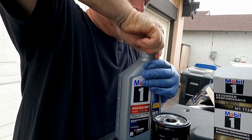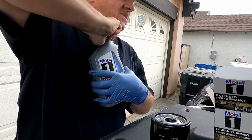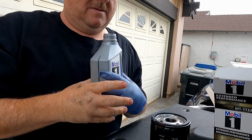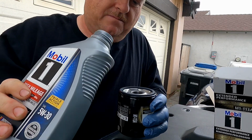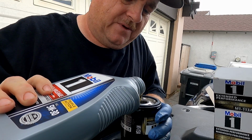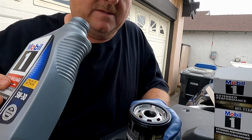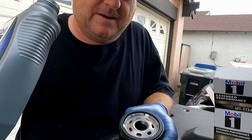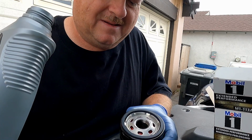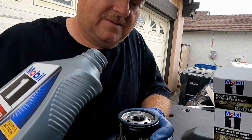So we'll get this open. It's going to be kind of tricky. Come on now, oil. There we go. We'll go ahead and pour some in. Now it'll fill all the way to the top. I don't know if you can see that. And then it'll go down. When it goes down, that's the filter media absorbing the oil. Once it settles all the way down, you can fill it up again.